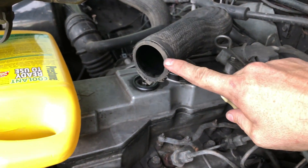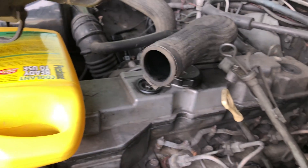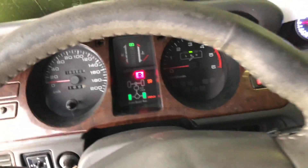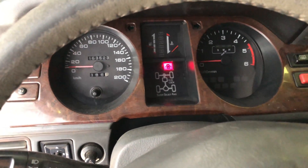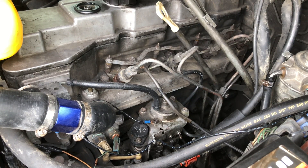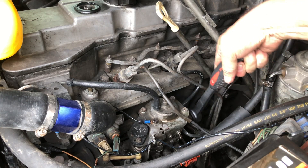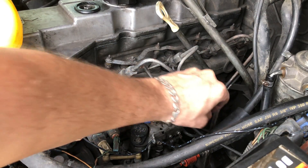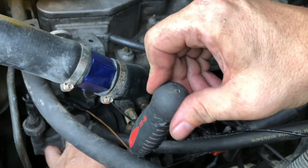If your engine starts getting away from you, put your hand over the intake manifold and it's going to turn it off. Okay, the ultimate test — see if it shuts off with the key. Nice! Okay, so that's fixed. I'm just going to lock this nut here for the fuel load screw. If you leave your socket unlocked from the ratchet it leaves enough space for the fuel line to pass between — at least on this engine it does. That's tight enough for now; I'm probably going to play with it again after it warms up a bit.